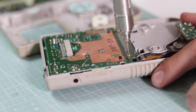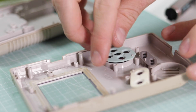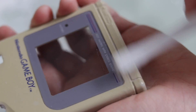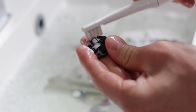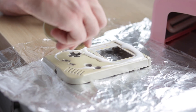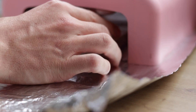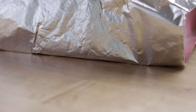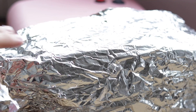To begin the restoration process, we take the other half of this Game Boy apart and clean it. It's important to note that retrobrighting is just the posh term for bleaching — you aren't chemically reversing a discoloration, you are simply bleaching the plastic. Retrobrighting is a very hit-and-miss art and the results are incredibly unpredictable. Also, we aren't sure of the long-term effects this process could have on plastic. Once the Game Boy is spotlessly clean, I will take some cling film and cover it in a thin coat of hair salon cream, which contains hydrogen peroxide — the bleach that does all the work. This is then placed inside a UV nail hardening lamp for a few hours, constantly checking it and removing air bubbles. The cream is replaced halfway through, and this is then repeated for the back of the Game Boy.